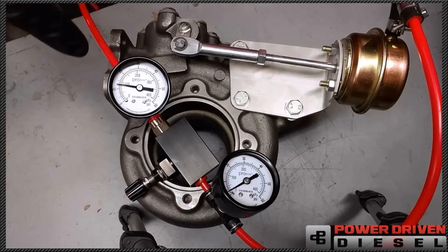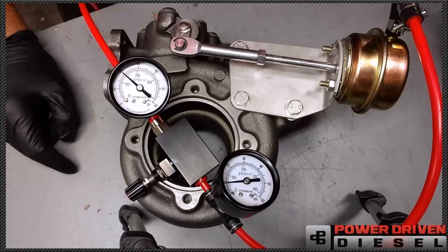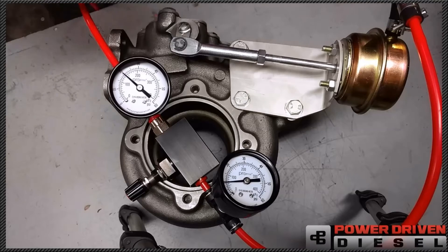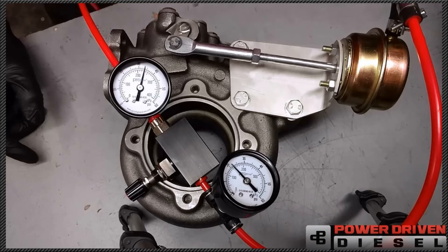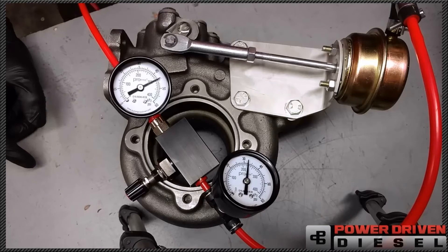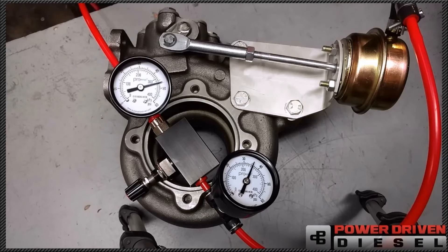So you'll notice these readings are very different. Let's go up to 20 pounds of boost here. At 20 pounds of boost, we have about 9 to 10 pounds of pressure on the wastegate side — it probably cracked around 10 psi. So we have 10 psi going to the wastegate, and at 20 pounds of boost this thing is now just about to crack. Now it's light — it's taking the tension off the spring. Going up to 30 pounds of boost, we're a little shy of 20 pounds of wastegate pressure. Up to about 40 pounds of boost, we're just under 30 pounds of wastegate pressure. We need about 45 pounds of boost to reach full wastegate travel.